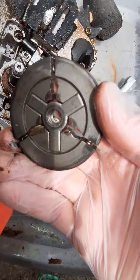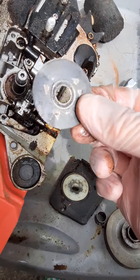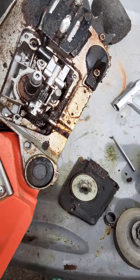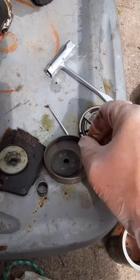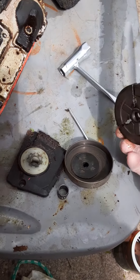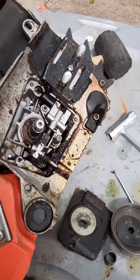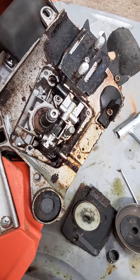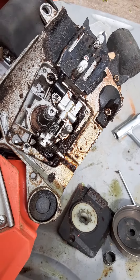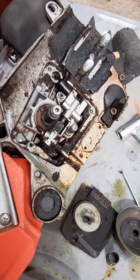This is a reverse thread, but before that goes on, always put the washer there first. The washer goes inside — you can see the washer goes right inside of here — and then the clutch goes over the top of that. And that's the reverse order for putting this back together. The reason I made this video is I always forget something and get a little confused, so now I have a reference point. Good luck in fixing your oil pump.